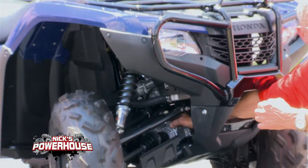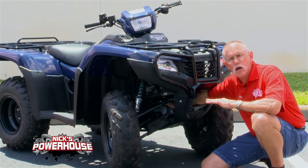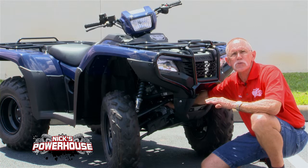At the end of the day when you're through riding, if you've been riding in a lot of deep water, you want to look in there and make sure that hose hasn't been knocked off. Because if you knocked it off and you've been running through some deep water, the water's going to get in there and penetrate, damage the oil, and you're going to wind up ruining your final drive.